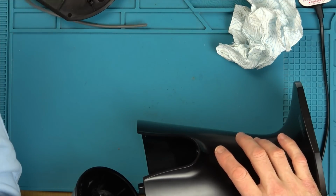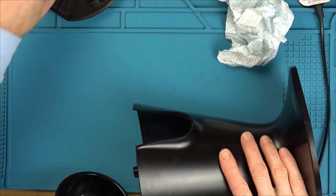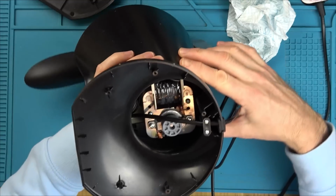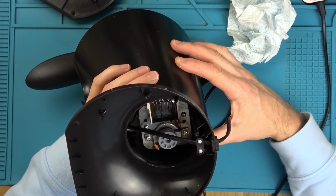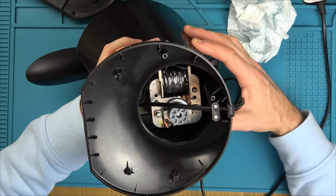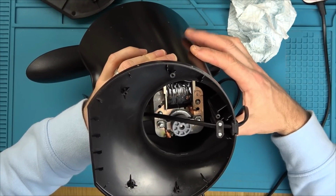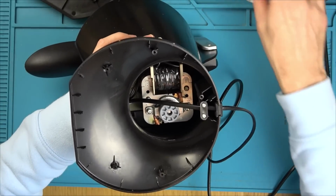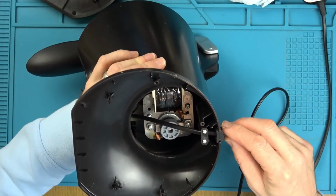Right, I can give that a good wash. That's seal. Oh, we have a big AC motor. So the on and off switch is working, it's just the motor's deciding not to turn, just hum. So I wonder, it must be going through a gearbox, otherwise it's going to be turning way too fast. So I think there's going to be a problem with the gearbox, unfortunately.